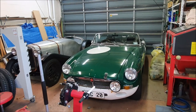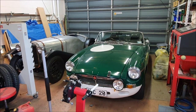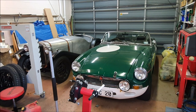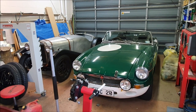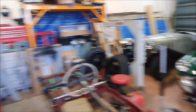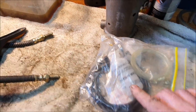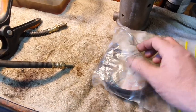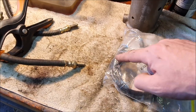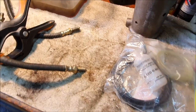That turned out to be successful — all brakes have been bled and the car's back to normal. The brakes don't feel any different to me, they seem just as good as before. The little brake bleeder I used is a Power Bleed-O-Matic — it's very simple, just a little bottle with a tube in the lid that goes down into the fluid and a little air hole on the top.